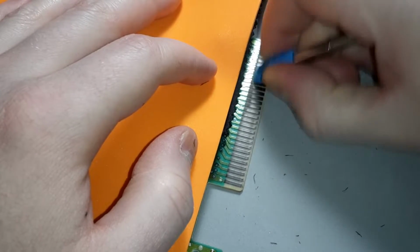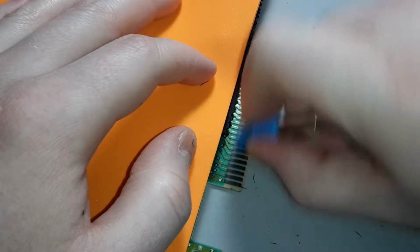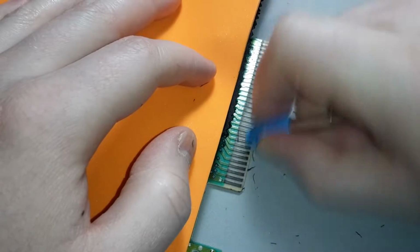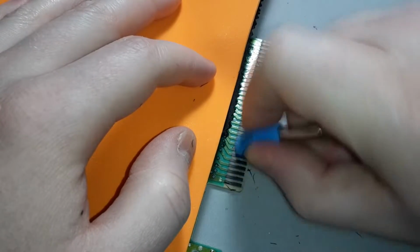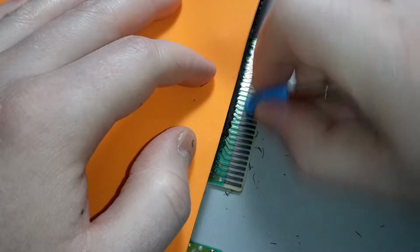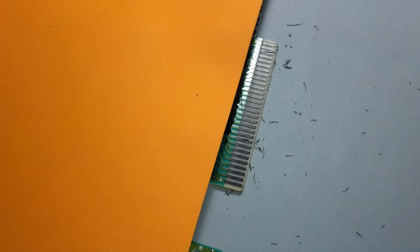And this one's to collect all the extra, see that? What that's doing is it's rolling along it and collecting it all up inside of itself to get all that extra dirt and grime. Notably, it's verdigris or tarnish. And this will help improve the performance of these contact pads for the Sega CD. And that Sega CD unit works wonderful. Okay, that worked out very well. All right, I'm going to clean up, and I'll flip the board over and we'll work on the other side.